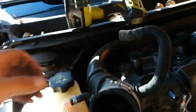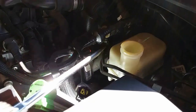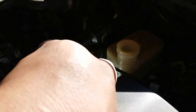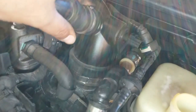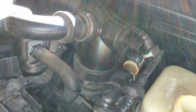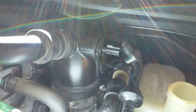Let's go ahead and disconnect this from here — there is a pigtail connected to it and a bracket. Go ahead and disconnect this pigtail. Let's use a flathead and throw some light down there to loosen this up. Now that this is loose, there's also a clip here we have to remove — probably use the needle nose to get that out. Everything is loose, should come off. Just grab some needle nose, pull it back out, and finish unclipping it.